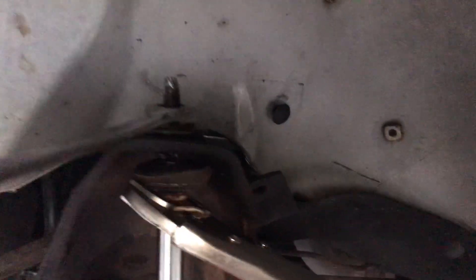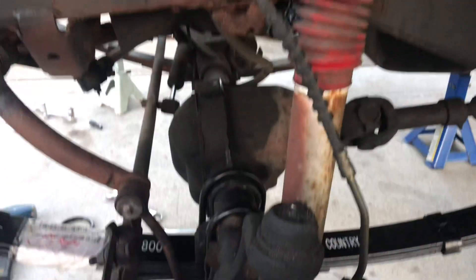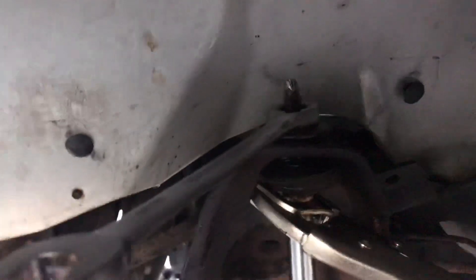All right, usually I do these videos when I'm in a pinch. So here's a pinch. This is a shock absorber that just won't come out of this Jeep. Usually shock absorbers have a little quarter inch slotted area where you can get a wrench on. As you can see, that one's done — clear sheared off. And it won't take vice grips either. It wants to shear off, nothing to hold it.